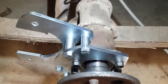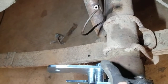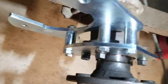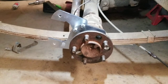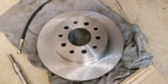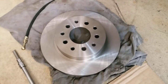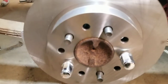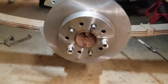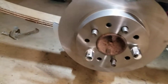There's our brackets on there. When we lean up this way, you've got bolt, spacer, lock washer, nut — all the way around, four times. So now we're ready to throw our rotor on. This rotor has several holes in it because it works on a bunch of different cars — GM, Ford, and Mopar. You've just got to find the right pattern and slip that baby right on there. We've got our rotor on there — make sure you grab a couple of lug nuts and put them on there to hold your rotor. Because if you don't, things are going to flop around when you go to put your caliper on. It's a headache — put a couple lug nuts on to hold the rotor.